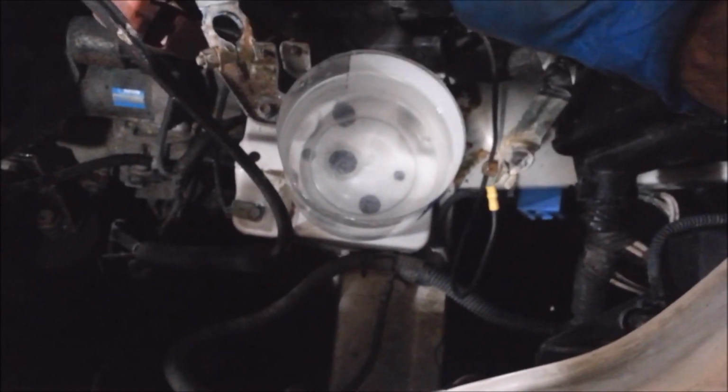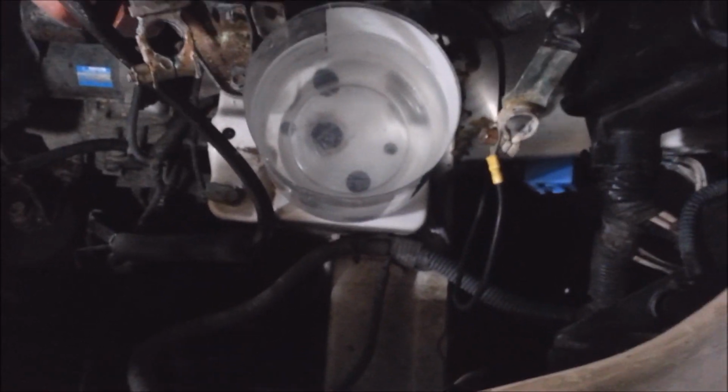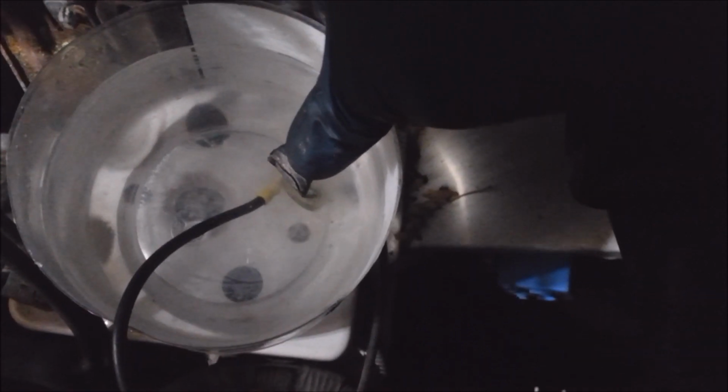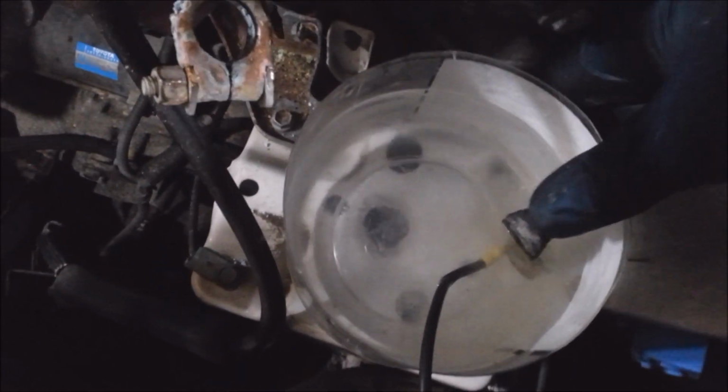Yeah, now for cleaning these battery terminals, I just made a solution of baking soda and water. I don't know, 3 tablespoons or something. I just cut a plastic peanut butter jar open. You just want to stick them in there. And you'll see it'll start foaming up. It'll bubble, bubble, bubble. You just want to leave it sitting there until it stops bubbling. And this negative and this positive terminal is the worst. These are really bad. Yeah, see that? Sometimes you gotta leave them sitting there for, oh, I don't know, about a half an hour or so. Just let it do its magic.